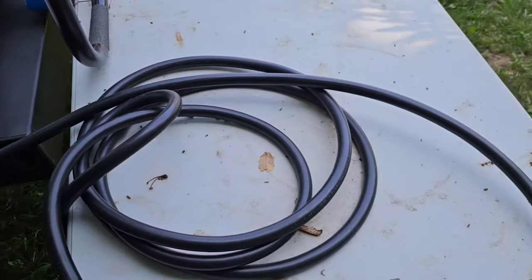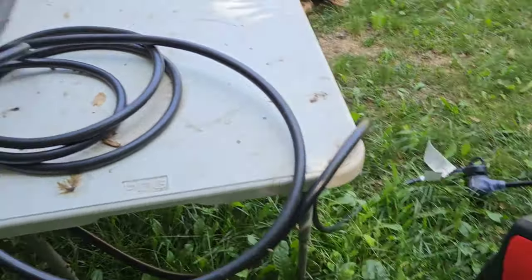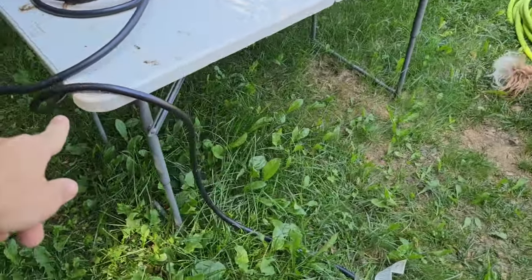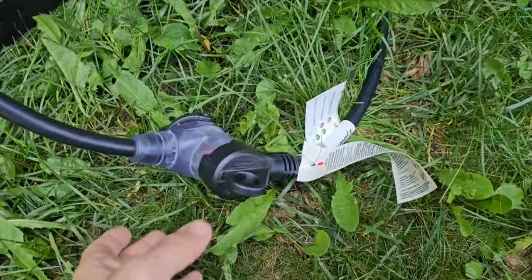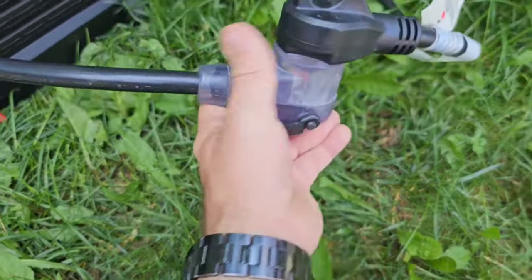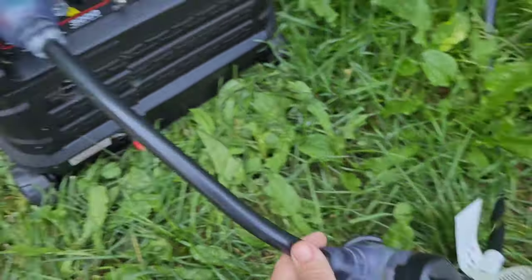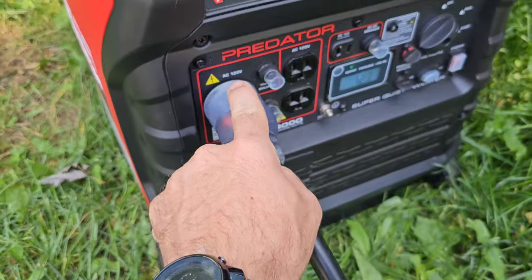Another comment: your cord's junk, using too many extensions. Well, this is a 2023 camper with a brand new cord. The only extension piece that I'm using is this 30-amp RV adapter to 30-amp twist plug in 110 volts. 30-amp campers only run off of 110. I had several people tell me I need to hook it to 240 volts — well, if I hook it to 240 volts, I'll fry my camper. I don't really feel like doing that. It's not my idea of a good time.